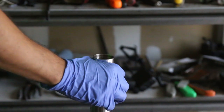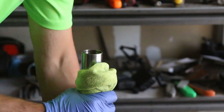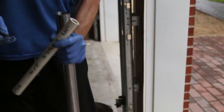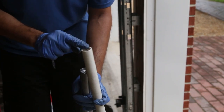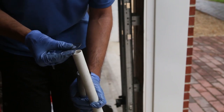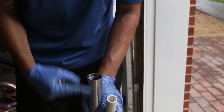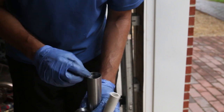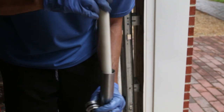The more you pump the fork, the tighter it gets — grab a cloth that doesn't have oil and pump it 20 or 30 times so everything gets worked out. One thing to note: when I removed the forks there was no spacer on top, but you do need a washer on top. My spring is already in there all the way at the bottom. I'm dropping in the washer now — just hit it so it seats correctly.